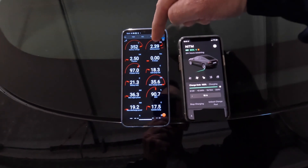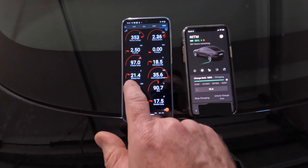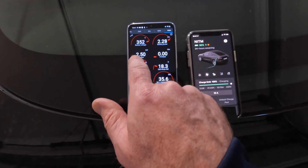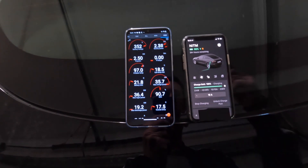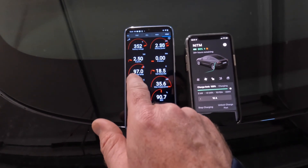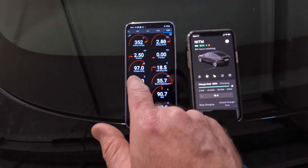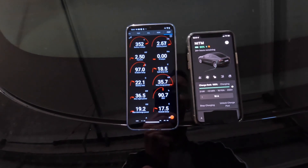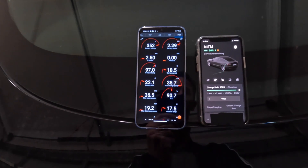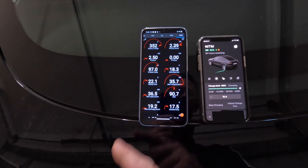We've got some draw from the battery from the heat pump — I can hear the heat pump going and we'll watch this battery inlet temperature rise. With that rear motor heating, it has coolant flowing through the rear motor, which then goes from the rear motor and circulates out to the battery. The rear stator temp reading has been playing up since the latest 2022.16 update, so hopefully Scan My Tesla will come up with an app update to fix that. We can see a reading there — the cell temp is starting to go up and I can hear the rear motor buzzing.